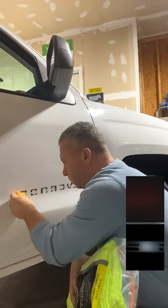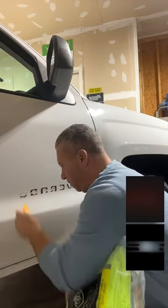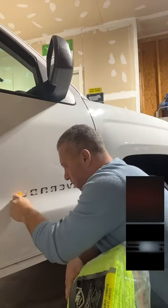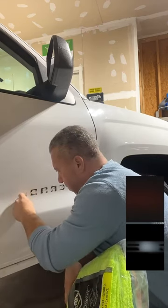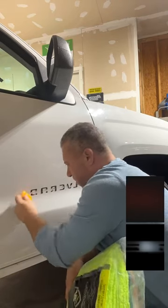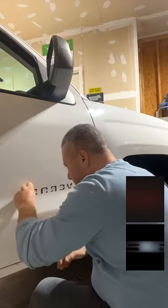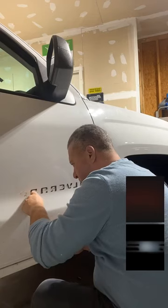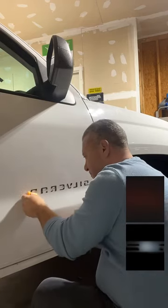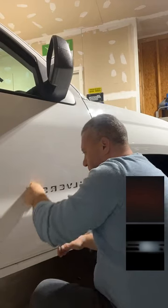But I'm just saying, prior to these rinseless washes, that's how we would do these kinds of things. For many years I've done touch-ups on car lots where I have to be able to wipe the cars down, and they're not getting detailed. I have to wipe them down to fix the scratches on the lots, and a regular spray detailer is not strong enough. So we would put baby shampoo in the water, or a very small amount of car soap, like half a capful, just enough surfactant. You're basically doing the same thing. The rinseless washes are engineered to work much better and much faster.